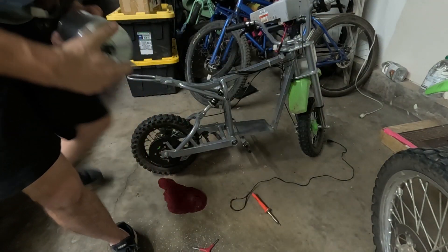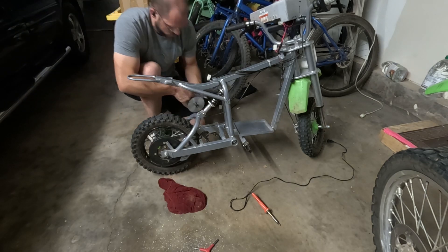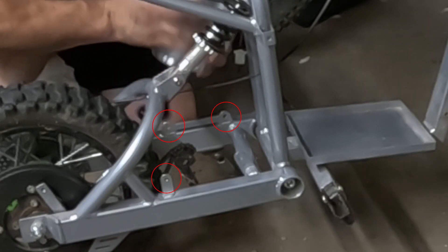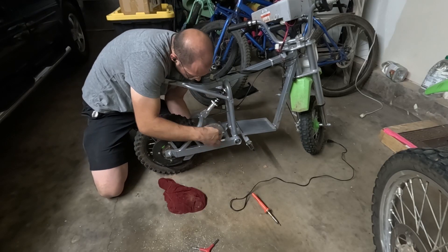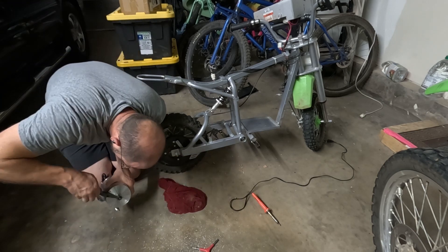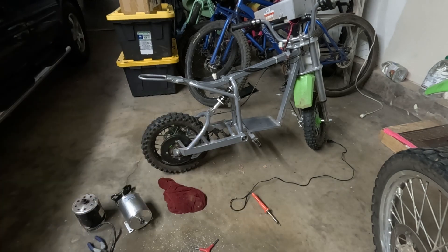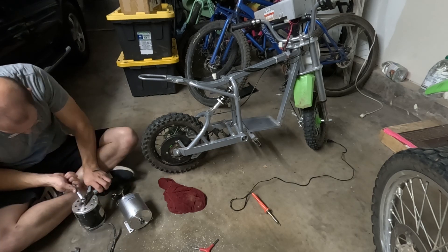As I'm putting the motor back into the e-bike, I'm going to attach it to the three mounting points, which are shown here. There are two on one side and one on the other, and you're just gonna stick it in. I threw it in upside down because that's how the mounting points fit for me. The bracket was just there — I didn't have to cut the bracket off or anything like that. It worked great. I wanted to do this long-form because I didn't see a lot of people on the internet who had this method.